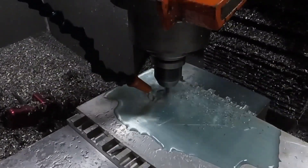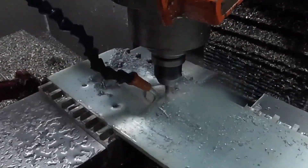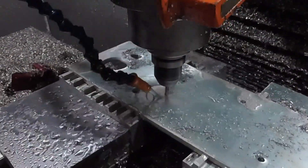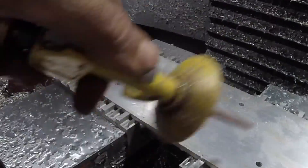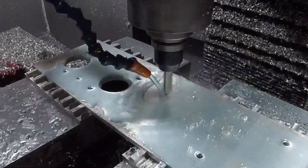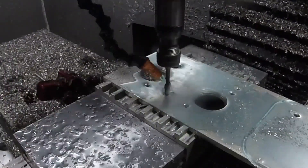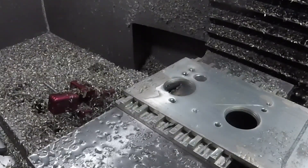Today's project starts with a piece of quarter-inch thick aluminum stock. What we're making is an air filter base and cap to mount to a Weber DCOE. The reason I'm making one instead of buying one is because I couldn't find a filter for that particular carburetor that was shallow enough to fit where I needed it to go. I had to buy a filter for a DGV series which was only an inch and three-quarters thick, and I've only got two inches of clearance.